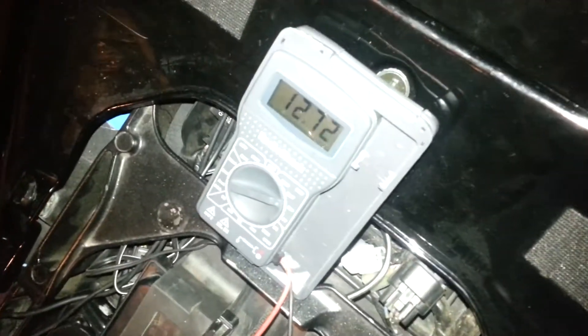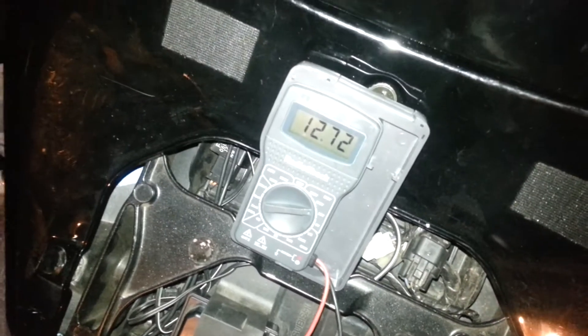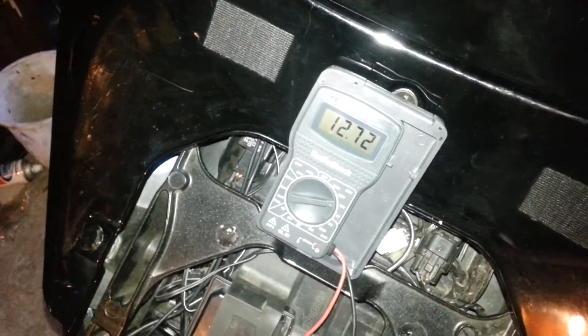What you're seeing here: the bike — after I charged it, I started it up a couple times just to make sure we were set. Anything under 10 or 11 volts won't start the bike. So right now I'm going to press the key.